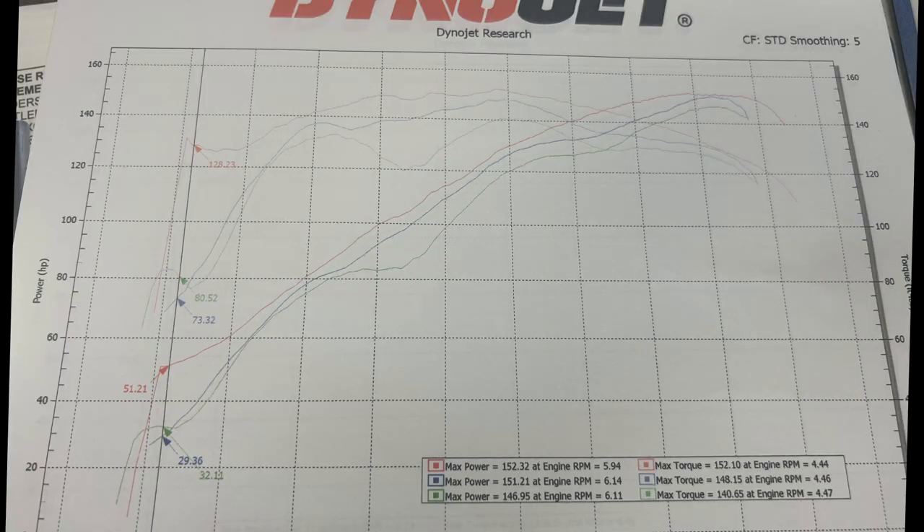Here's the dyno graph of this bike. I tried three different exhausts to find the best combination. The green line is the Bassani 2x1, the blue line is the FuelMoto Riot RTX 2x1 Shorty, and the red line is the Chromeworks Dominator. As you can see, the Dominator makes a whole bunch more power throughout the whole range — especially down low at about 2,000 RPMs, there's a huge difference. That pipe is a 2x2 with a crossover and makes more power than both 2x1s. Thank you for joining me here at EMP Cycleworks. I hope you enjoyed this build and I look forward to making the next one for you.